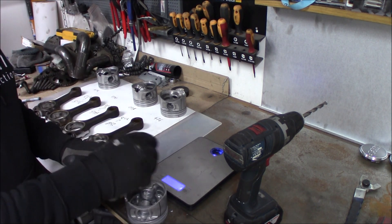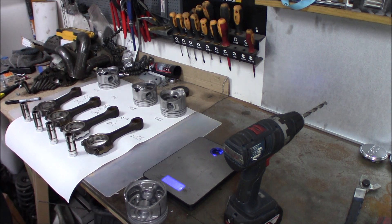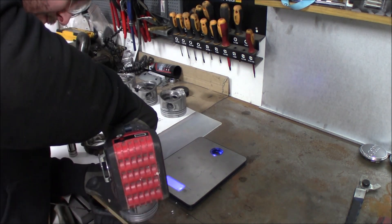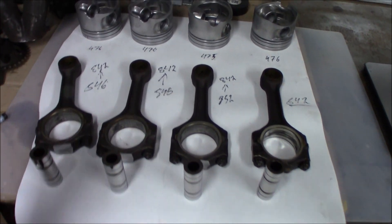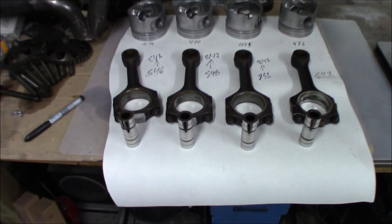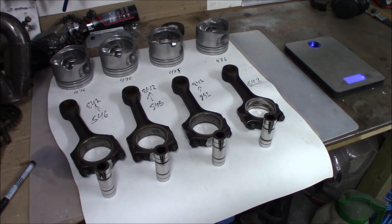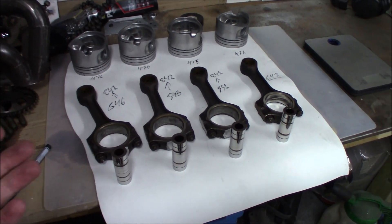Always stop along the way when you drill a bit and then weigh it, so you don't go too far — otherwise you'd have to adjust all the others to follow that one. It's quite a quick job, and on some pistons you barely had to remove anything at all. Now everything is equal weight so the engine will run really stable without vibrations. Of course, if you're doing this the proper way you should balance the crank together with the flywheel and everything, but this is better than nothing.